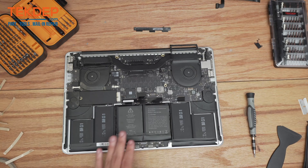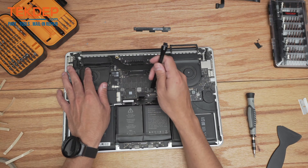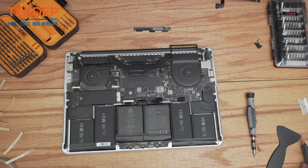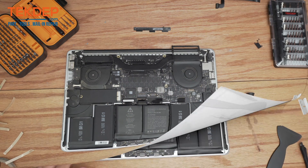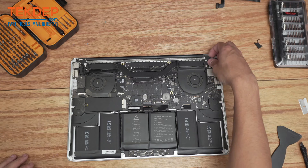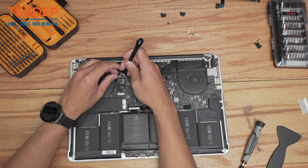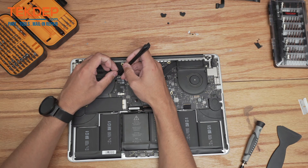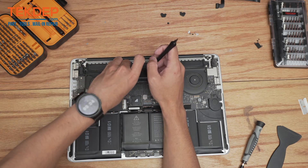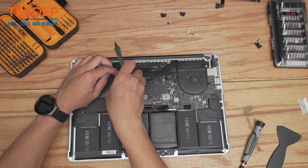We're actually going to go ahead and unplug that cable one more time because we are going to replace the LCD on this unit as well, and we don't want power flowing through the unit when we are working on anything inside. To prep the LCD for removal there are a couple of things we have to do first — we're going to start by removing these little rubber covers, then unplug all these Wi-Fi antenna cables. It looks like one was broken. Now we're going to prop up that Wi-Fi card and pull it out and set it aside.